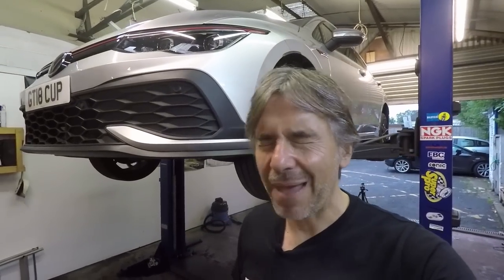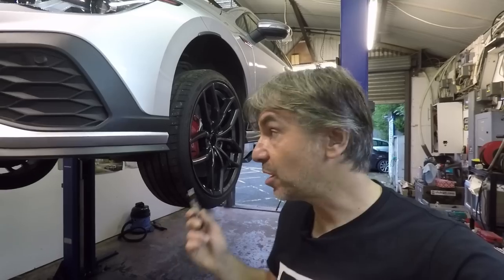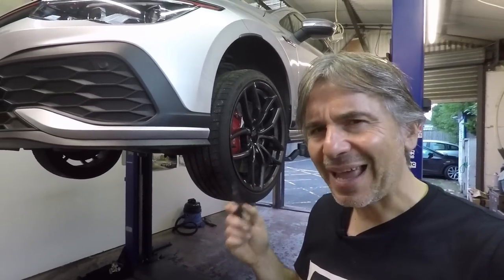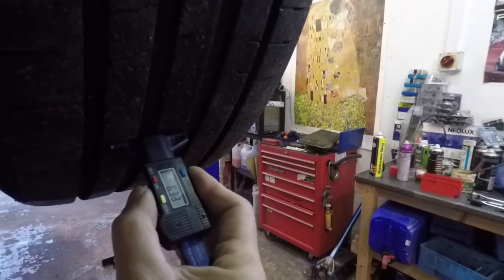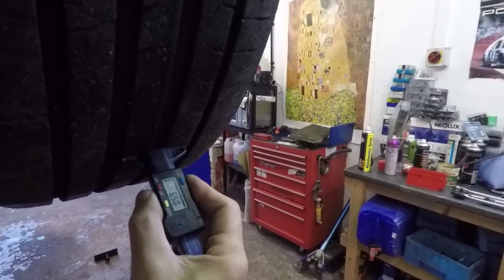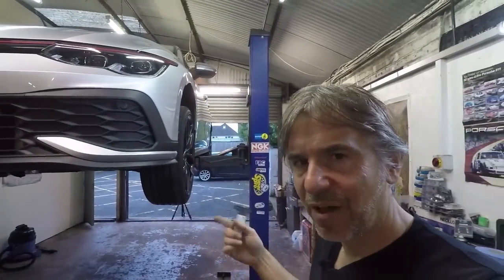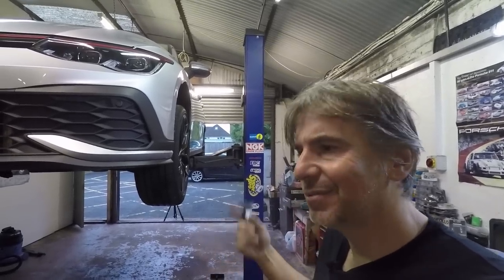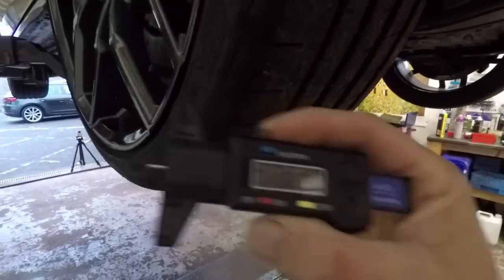Next thing to do is measure the tyre tread depth — it's just interesting to see how well these tyres have worn. I've done about 8,000 miles on these Goodyear Eagle F1s. They went on when the car had done 1,000 miles, and I swapped them front to back roughly towards the back end of summer. These were originally on the back — 6.3mm here and 6.5mm there. They come brand new with 8mm, so they've only used about 1.5mm of tread, meaning there are quite a few tens of thousands of miles left on those if you keep rotating. The other front measures 6.4mm and 6.5mm — pretty good.